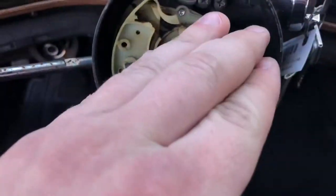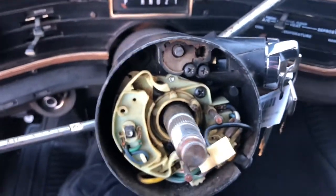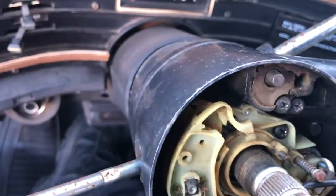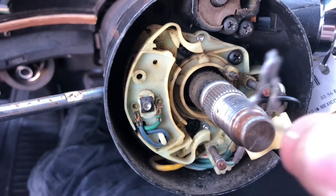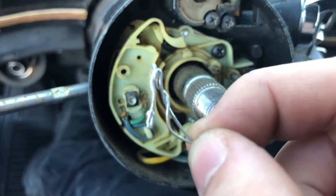This is what it looks like — steering wheel off, nothing else has changed. And you'll notice right here there is this hole — that is where the retaining pin is. The way you depress it is you're going to want to get something that can fit in that hole and is sturdy. This is a paper clip I folded up, but it did the job.